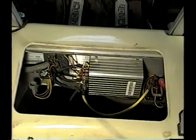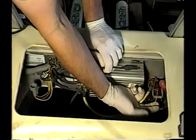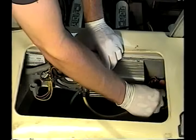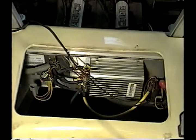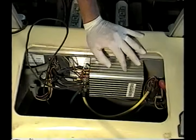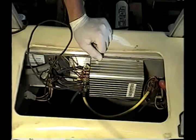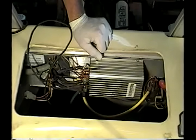With the computer disconnected, if we put it in gear, turn on the key, and step on the accelerator, you'll hear a little bit of a whine but then the car won't run. The way to bypass this computer is to take a jumper cable and go to the solenoid on the small low-amp terminals. Find the terminal with the yellow wire — leave all the wires intact — hook one end of the jumper cable to that terminal with the yellow wire, and connect the other end to the battery-last negative, right here on this stud on the controller. Now put the car in forward or reverse, turn the key switch on, step on the accelerator, and the car should run even with the computer disconnected. So now we've bypassed the computer — that's the easiest test for a 48-volt system.